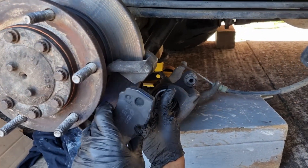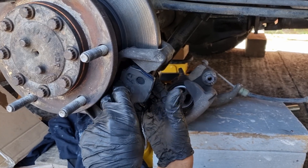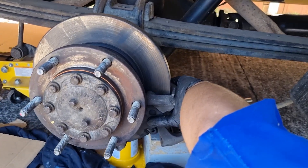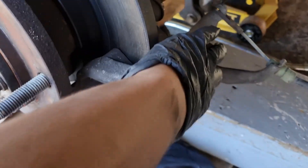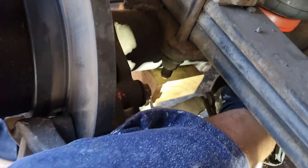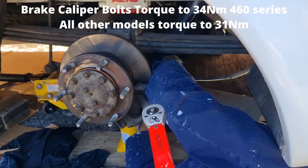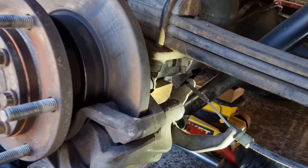Slot the caliper in — you have to hold it in place because this caliper is facing down against gravity. Because this caliper and brake system was serviced just about six months ago I don't need to worry about it, but if you're doing this job I would highly recommend you check your glide pins and your brake system. The caliper bolts are torqued to 34 Nm for this 460 vehicle. The caliper glide bolts are 34 Nm. If you need the specs, just refer to the end of the video.